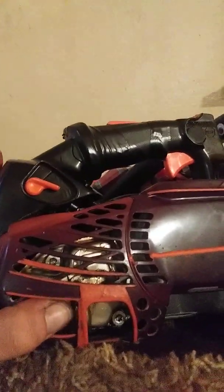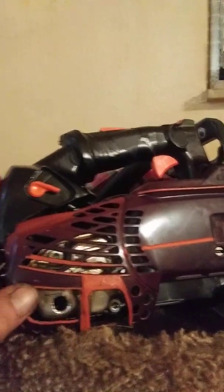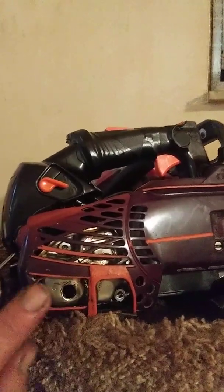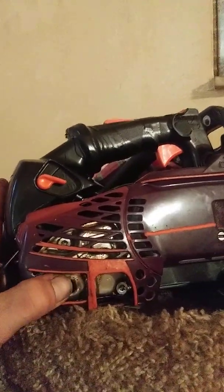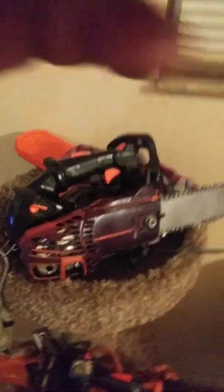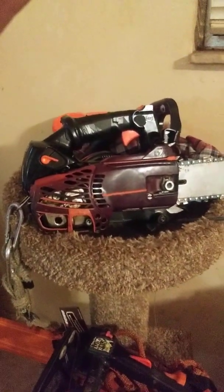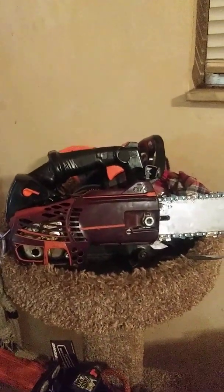You can see how well this saw runs even with that tiny OEM slit muffler. After the four-degree ignition advance and serious muffler and exhaust flange opening, I'm still getting around 25 minutes of idle time, which surprised me. That's a testament to this little saw — it's coveted by pretty much all climbers for a reason. Once I've messed with it a bit longer and done my stage two, I'll be back with more. Thanks for watching, hope this could help someone out.